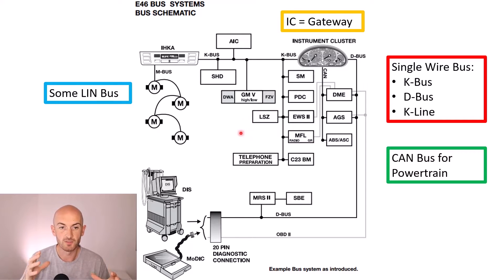You can see that the body network is quite busy. We've also got hardwire connections going up to the engine control module — that's the hardwire connection for the immobilizer. This era of vehicle was notoriously hard to steal; you needed the key, otherwise you physically couldn't start the car. The multifunction steering wheel was also connected to the engine control unit for the cruise control switches.